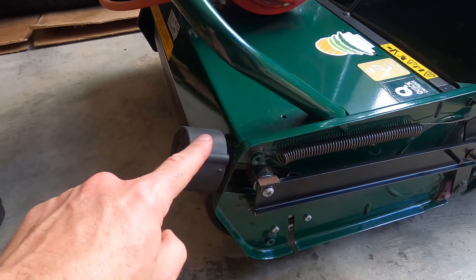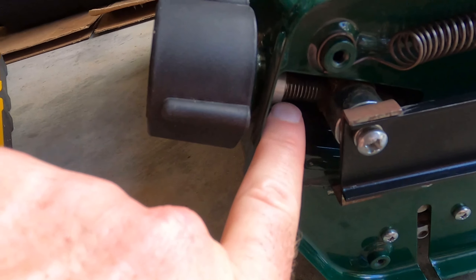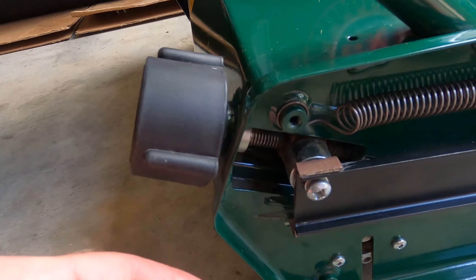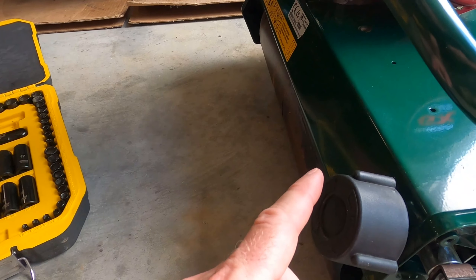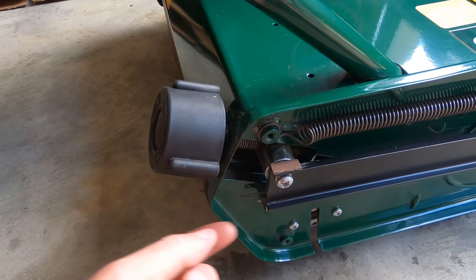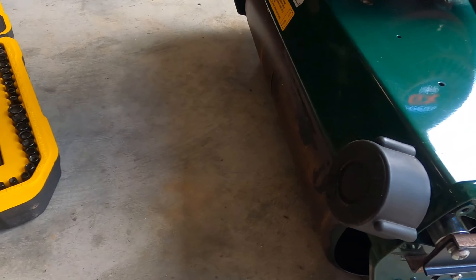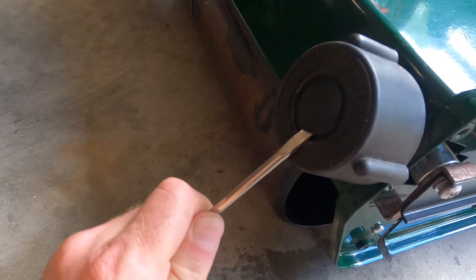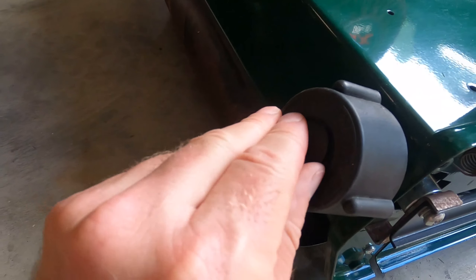My first season I was scarifying and I rolled it down all the way to the bottom. This is basically a long screw — you can see the threads — and it bottomed out on the screw. When I tried to bring it back up it would not catch. I kept turning and turning. What I ended up doing is loosening this, pushing it up so it would get on the thread. A little tip on this knob: there is a cover on it. I've had several people ask me about it — I sent them pictures on Instagram direct message. You can pop this little cover off.